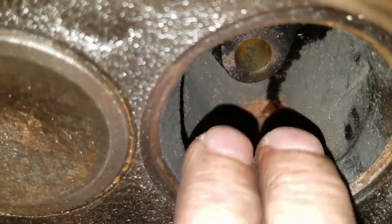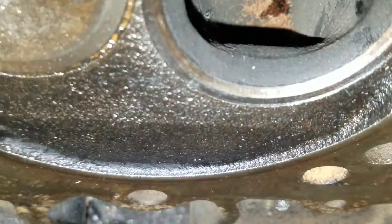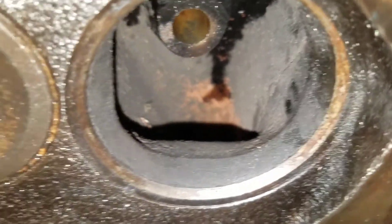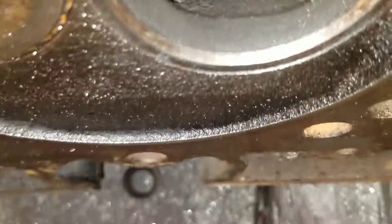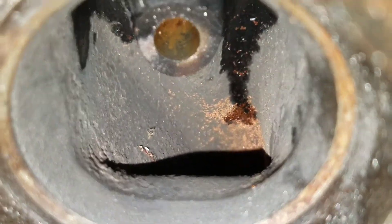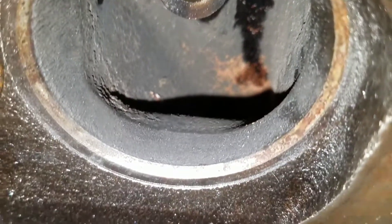The 906 head has what small block guys would kill for in a short turn, so it seems. Maybe not kill for it, but pretty damn nice. There's a lot less to get out of the way. It rolls up, it peaks nice and comes down towards the floor.